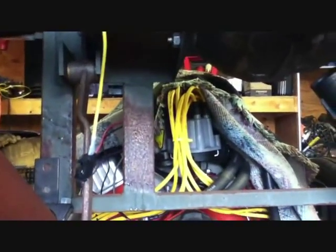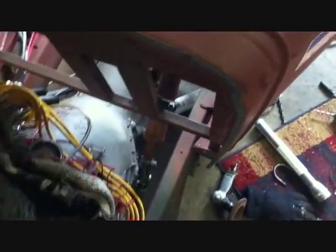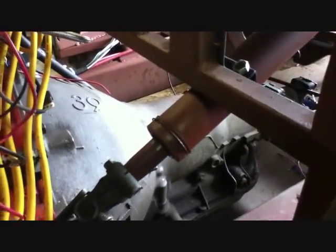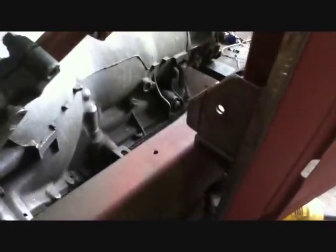It might run out with the throttle cable, so it'll probably be up there somewhere. Thank God I don't have a firewall insert yet, because I can still drill holes here. I might actually make it in aluminum so it's removable. I've got to make cardboard patterns for my shaft for the steering column — it's going to be an oval, of course, to clear it.